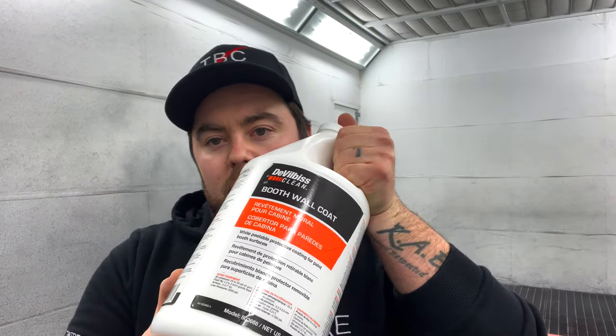Hello everybody, Sam from the Body Center here. Welcome to booth one. This is our USI Italia Chronotech commercial oven. We have three here, and we're now going to take you behind the scenes to show you how we apply the DeVilbiss booth wall coating. Now this is a peelable paint, so as you can see here, we have the 3M dirt trap wrap. We're going to be removing that and painting the booths white with this peelable paint.